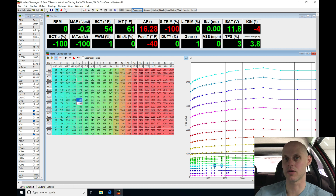We should see approximately zero. The only time you may not is if you're at very high elevation — you might find your MAP sensor reading something like negative two or negative three inches of vacuum depending on elevation. As we go up in elevation, the MAP sensor will read more and more into vacuum. My elevation right now is between 600 to 700 feet, which is why we're reading approximately zero. At sea level it should read almost exactly zero.